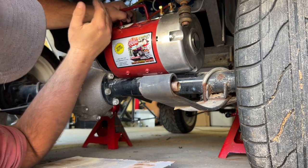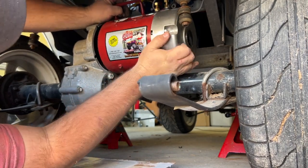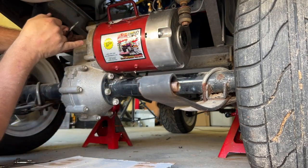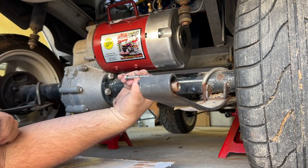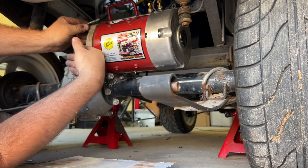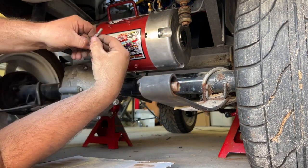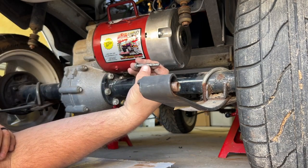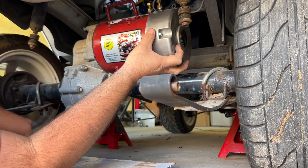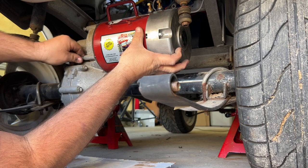I can use my left hand to pick up the front of the motor and my right hand to adjust the level on the back side. It's in place. Once you get the motor on, slide it all the way until it hits the transaxle mount. You never want to use a bolt to compress the motor against the transaxle — you always want the motor to slide on freely. The bolts are only used to tighten the motor to the transaxle. I rocked the motor a little to find the sweet spot and lifted the back of the motor slightly to help the bolts align into the holes.